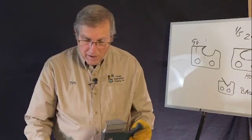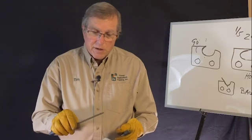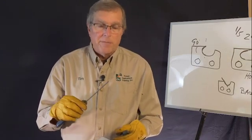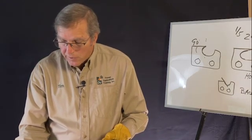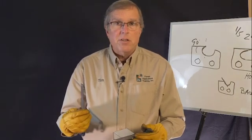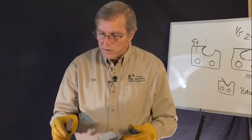There's also, and going back to what we talked about with the file size, I just happen to think I have a chisel bit file here. This is for square ground chain. And this particular file is a 6-sided file that more or less puts a channel up to the point of the tooth. You see this a lot on the West Coast with professional operators. You don't see it too much anyplace else in the States.